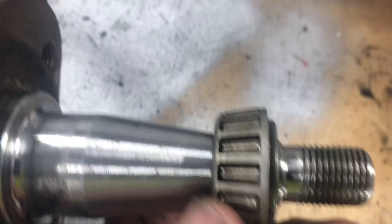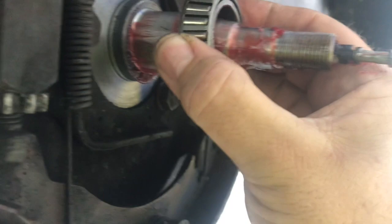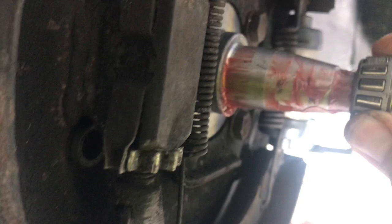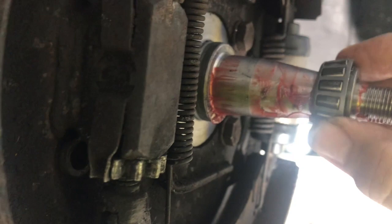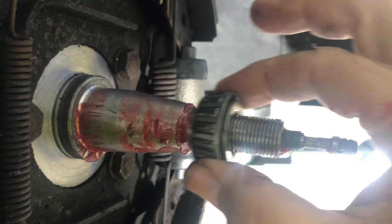For further comparison I went back to the driver's side with an old bearing on the new spindle — it goes right over, nice and smooth, with just a slight hang-up at the edge. Then we tried the outside bearing and it's actually fairly loose. So we have one spindle with bad tolerances and one that's good — driver's side is good, passenger side is bad. That's MP quality for you.